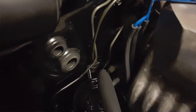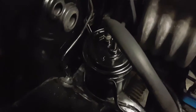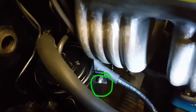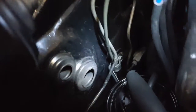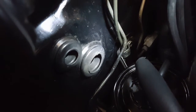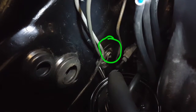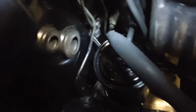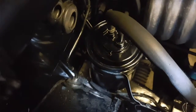Alright, so I finished — now that I got the clutch hard line in, I went ahead and reinstalled the charcoal canister, which is the black canister you can see right there. It has two mounts — there's a bracket right there that rings around and you tighten it with the nut and bolt right there. The other side actually goes to the bracket I used for the clutch line, so I had to share that — I took the bolt out and put it back in with the charcoal canister bracket in place.